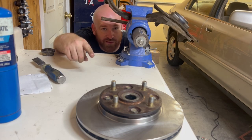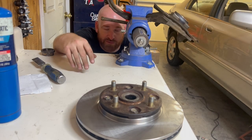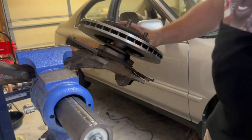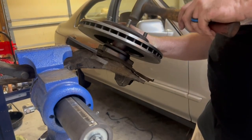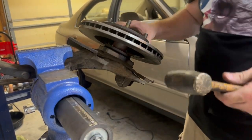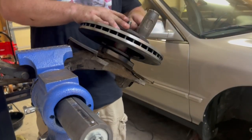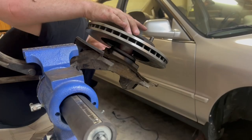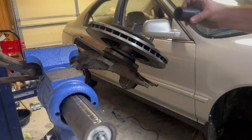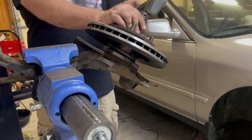Now to smack this one in. We know this one's good, so I just gotta get it in there. I'll be ready to at least put one side of the car back together. Just like the other side, a few light taps to get it started. I do have some grease on there. Got the old brass hammer out because I don't want to gall anything up. Now that she's starting to go in there, grab the old 30 millimeter socket — and my BFH — and I hope it doesn't fall on my toes.